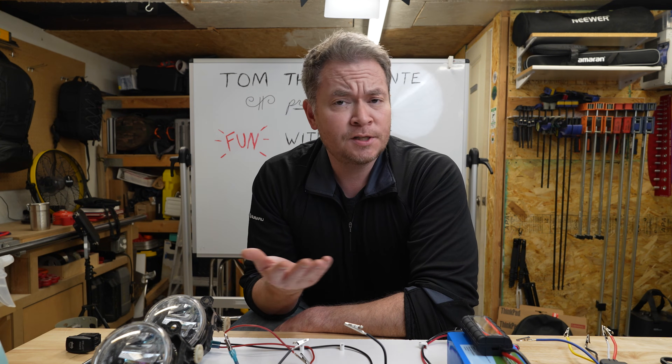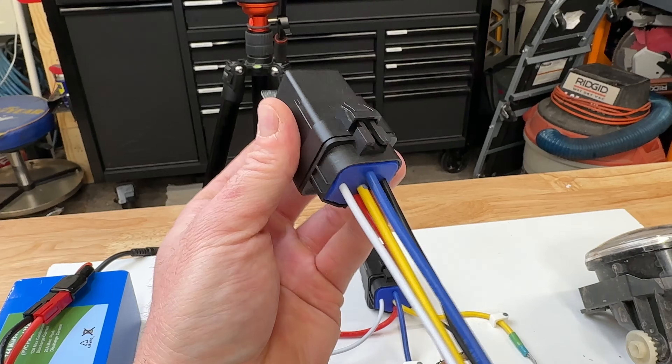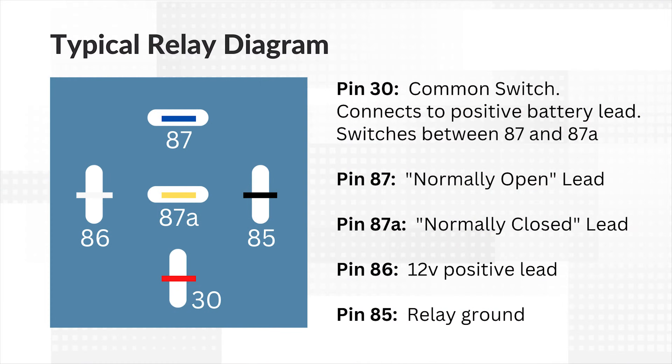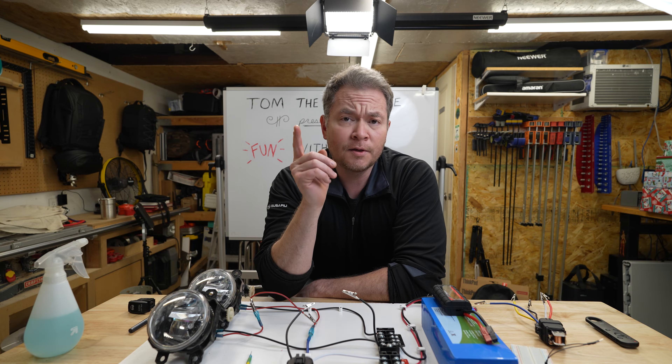Let's start answering that by first taking a look at the wires that come off the relay. Here we have five different wires — it looks confusing until we look at the wiring diagram. Each of the five wires has a purpose. The red wire on this relay goes to pin 30, which is the power lead going to the battery. Power from the battery will either go to pin 87A (the yellow wire) or 87 (the blue wire), depending on whether or not the relay is switched on or off.